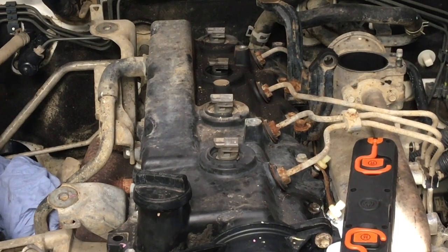Guys, in case you didn't know, new injectors, new pipes. That doesn't mean you fit new pipes and then 6 months later get new injectors. You can reuse the pipes 3 times on the same injectors, new pipes. You can say, oh, I'm wrong, I did this and I've done that. You can do whatever you want. There's this thing called luck. And if you're lucky, that's fine. We don't deal in luck. Luck's not reliable.